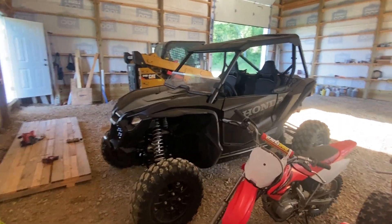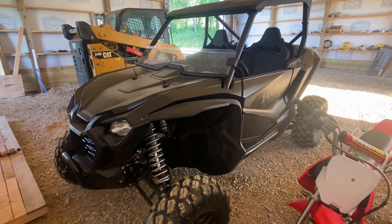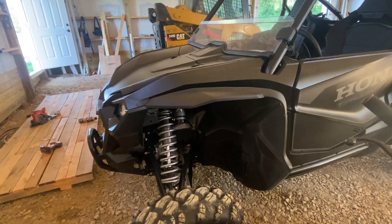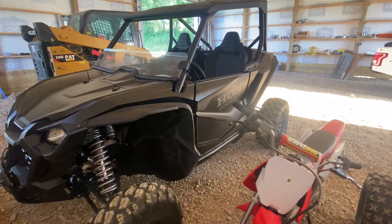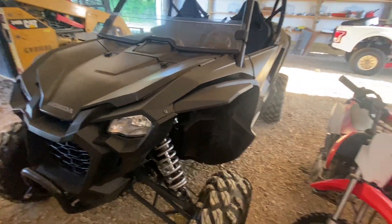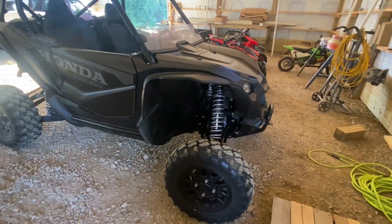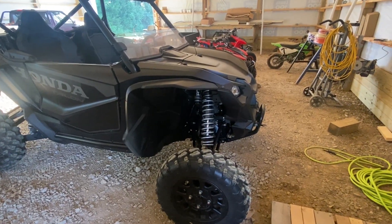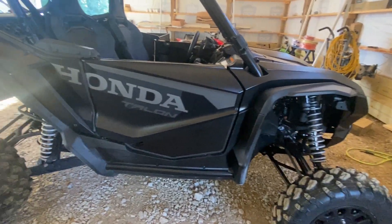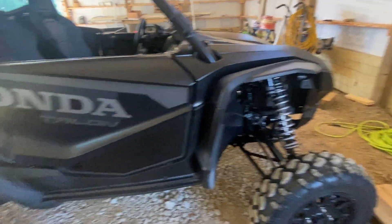Alright, Talon spring recap — just got back from Silver Lake Sand Dunes where we were for about a week. I put about 300 miles on these Shock Therapy springs. Overall a really good upgrade — definitely lighter spring rates, but with tuning the crossovers you can still get pretty good bottom-out resistance. I was running this alongside a stock 2019 that we had recharged the shocks on, with similar compression settings and ride heights.